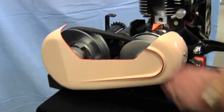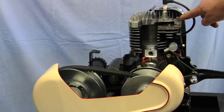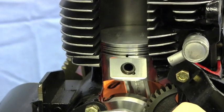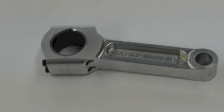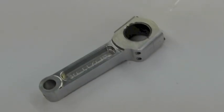We're going to get back over here to this side to show you our aftermarket billet head, our inch and a half valve that we put in to increase horsepower, our rod and our piston, and this is the stroker rod. This rod — or rather this crank — is 3/16ths longer than your other one, giving you a 3/16ths longer stroke.